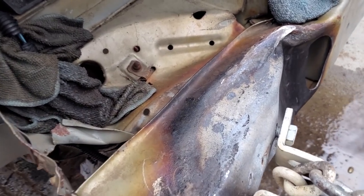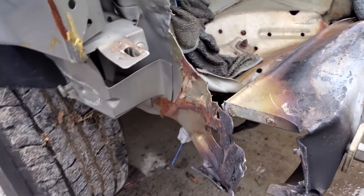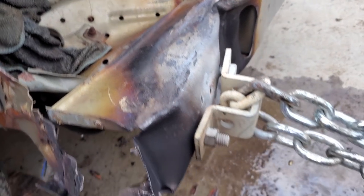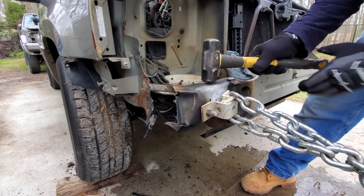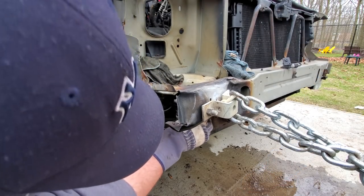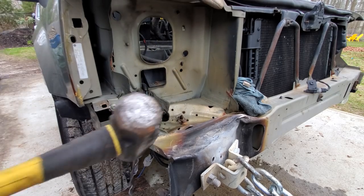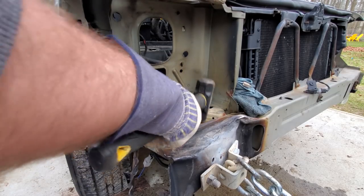Here's where we're at so far: we were able to pull the bumper out of this corner and it's starting to unfold. Not too bad. The welds kind of disconnected off the bumper and the frame, but when we straighten it out I'll just tack it back in. Progress. I think I can disconnect these melted horns now. I just have to whack this little piece down to hopefully unbend the piece of metal the horns are attached to, then take off the melted horns and maybe get a two-by-four and straighten the bottom piece out.